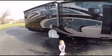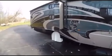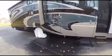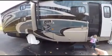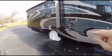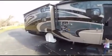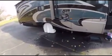The only thing that's left after we purge the water, we'll just close everything back up, and then we will add a cup of RV antifreeze down each trap. That's the sink drain, the shower drain in the bathroom, and the bathroom sink. So basically 3 traps within this model that you want to add to. And that's pretty much it.